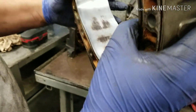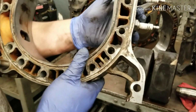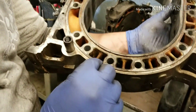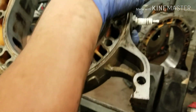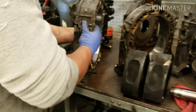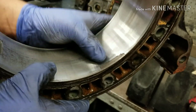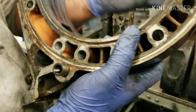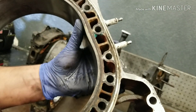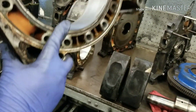All you want to avoid is big deep scratches. All the cooling passages have to be clean, because if this little gasket thing breaks you'll have a leak. You got to get a little scraper and scrape all of them off — if not, later on when you're cleaning it'll be broken. This one's bad — got a big chrome piece missing, that's gonna lose a lot of compression, and right about here it's gonna break. So this one's not really that good; it could be reused but I wouldn't trust it.